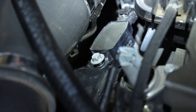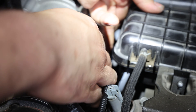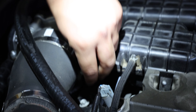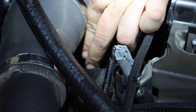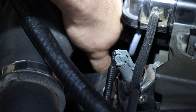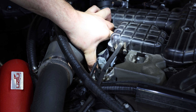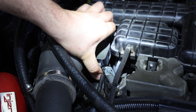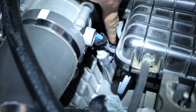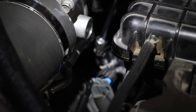We're going to follow the same procedure as before. You do have to remove these little safety clips in order to undo the connection to the coil — this one may require two hands. Squeeze down and they come off nice and easy. You can then remove the mounting screw for the cylinder number four ignition coil and slowly work number four up and out. Remember to always wiggle it as you go — don't just blindly pull. Wiggle it as you're going out and it'll make its way up. Now that we have this area freed up, we can work on the more space-starved cylinder five ignition coil.